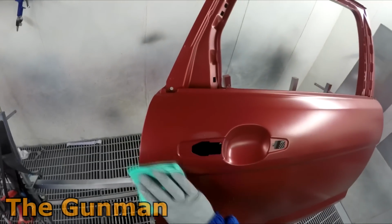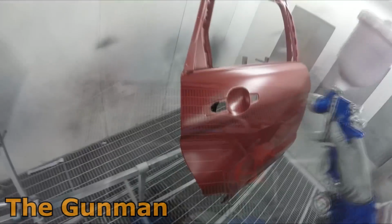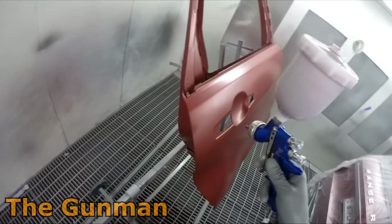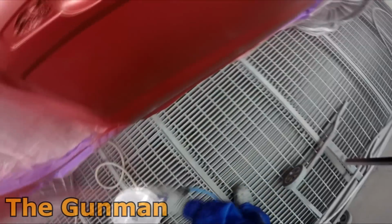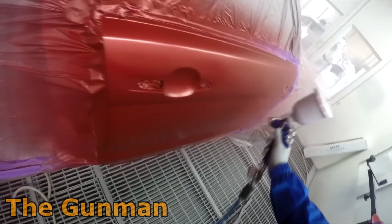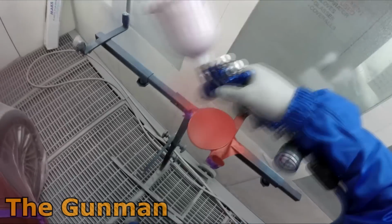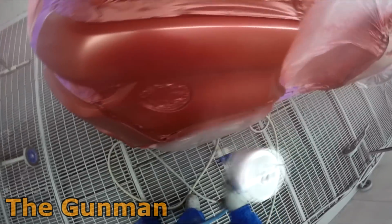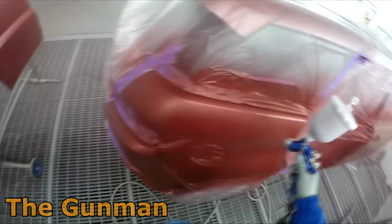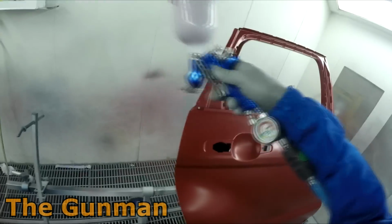But back just a couple of months ago when I made this video, I was using the TE20 for base and clear coat. That's one of the Transtech air caps, and they've still got really good transfer efficiency rates. They're not overly wasteful, and they get probably nicer, flatter finishes than what you will get with ease in a HVLP spray gun. Yes, if you know how to use a HVLP spray gun and you get the pressure up and you hold the gun nice and close, then you can still get some really nice finishes with them. I used them for years when I was working at a BMW shop, and obviously if you're working on luxury prestige cars, you still have to get really nice finishes, and you can, but it's just easier with your standard air caps like T20, T110, TE10. They're all good air caps for the Pros and Pro Lites.